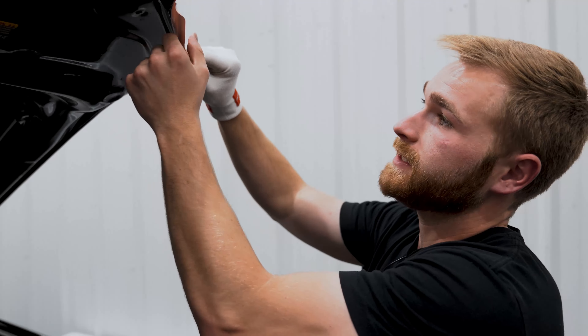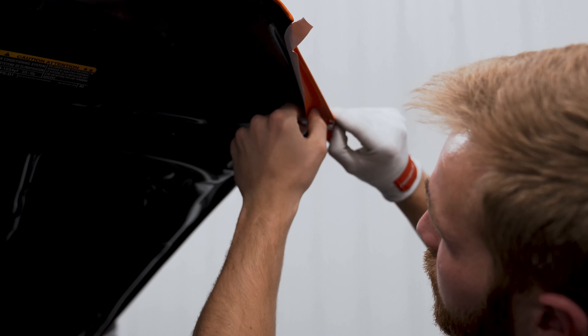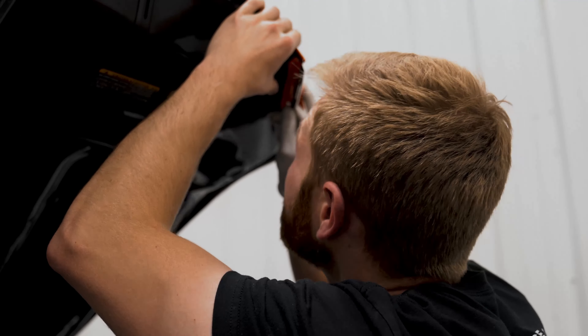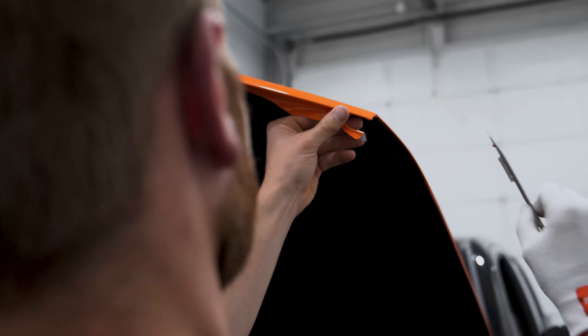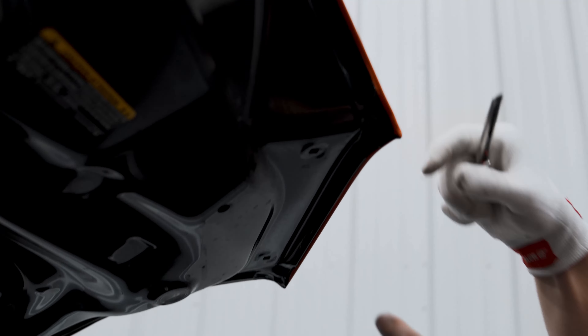Now that we have the hood open, we can take this extra film and roll it around to give it that cut. We typically want to cut at the glue seam — it gives you a straight line to follow. We're going to take our knife and hand-cut this edge on the glue seam. Don't press too hard so you don't cut any paint. Flow that cut out to your corners, and when you peel that off you are left with a straight line. You may have areas where it's not super straight, so just hand-cut those little areas to clean it up.